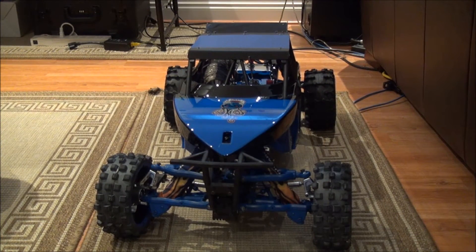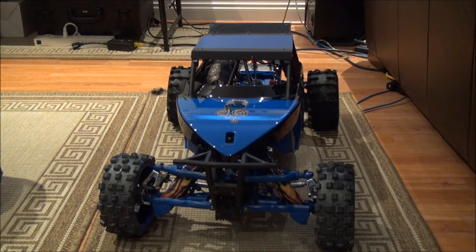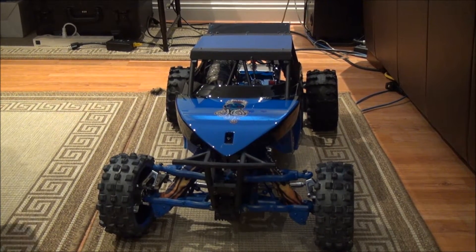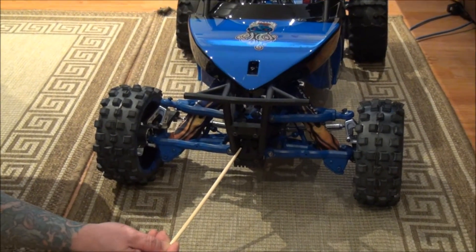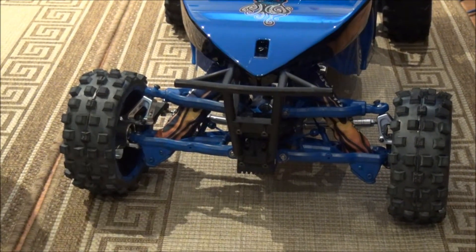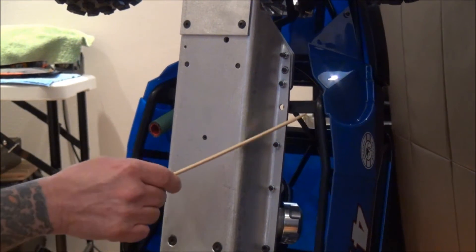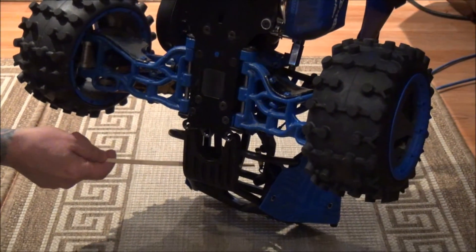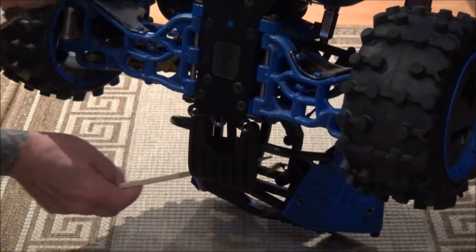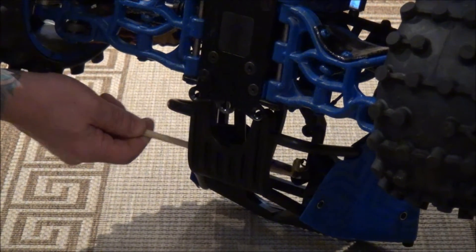The shell has three mounting points to take it off and it's relatively simple once you know where to do it. You've got two screws right here that need to come out, two screws hold it in from the brackets on the side, and at the bottom I have some clips with yellow tangs that are quick releases — pull those out from the bottom and the whole cage comes off.